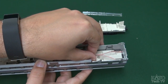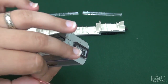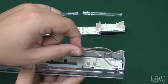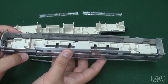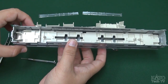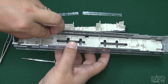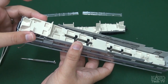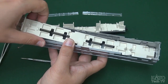Same thing - just pop it up and pull out. These are slotted into the body and they form these little lights here, so you want to be careful that you don't just pull them up, and you want to make sure you remove these before pulling the interior out. This might be a little tricky and may take a little brute force and ignorance, but what I'm going to do is just loosen this. I've got this side loose.